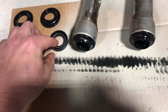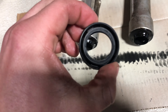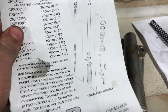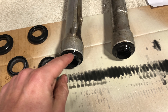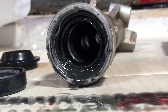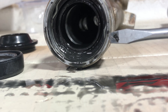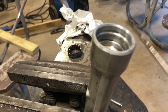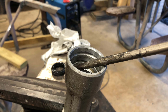The seals are two-piece — these go in first. They have springs so you've got to be really careful. After that first seal there's a little clip, and you can just pop it off with a screwdriver. Squeeze in with two screwdrivers and that seal inside pops out. To get the seal out after you get that snap ring out, just stick a screwdriver in the middle, right at the very bottom, pry up and it pops out.